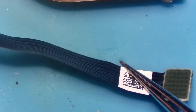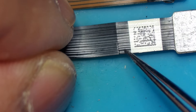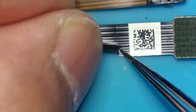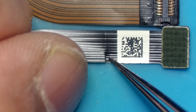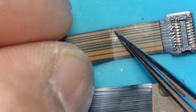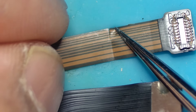Wait a minute - what's this? Look at that - I think there's a break. Yes, there is! There is a break in the cable here. I think I've found what our problem is. When it crashed into the tree, not only did it break the frame of the gimbal, but this cable here - let's have a look from the other side - yes, definitely there's a tear in this cable. My thoughts were correct on this, and we have a ripped cable.